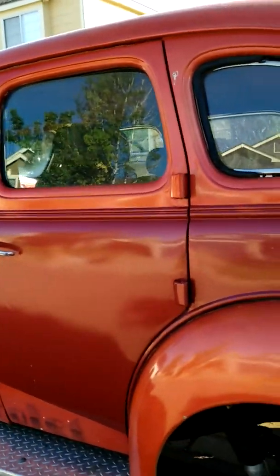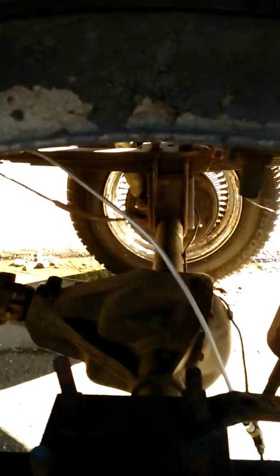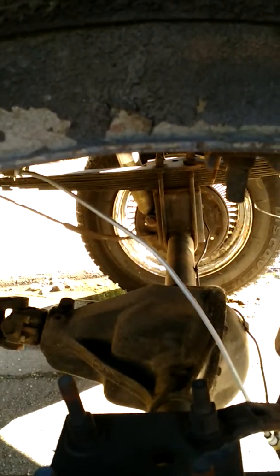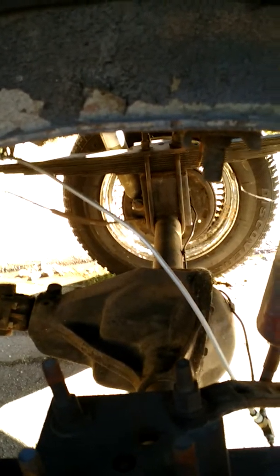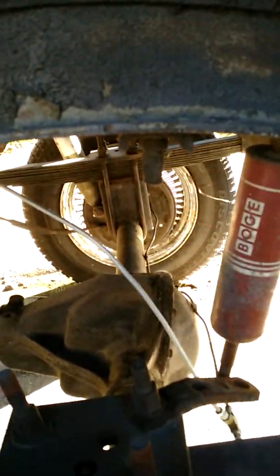There are a couple of rough spots which I'll show you. The rear suspension is leaf spring suspension on these blocks. You can see on the other side the big shocks are what are being used. The smaller shocks I think were just a backup or maybe original, but they're not mounted and they don't get in the way. So lowering the rear wouldn't be a big deal.